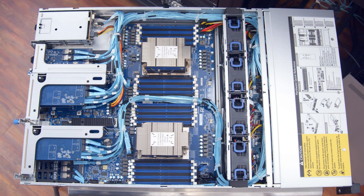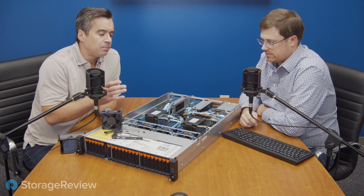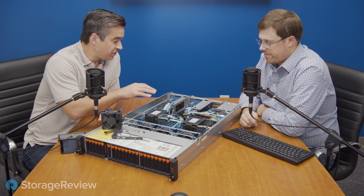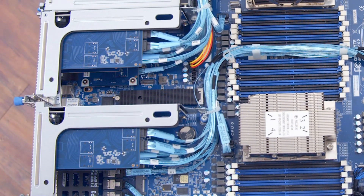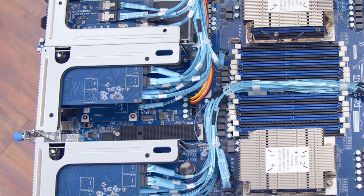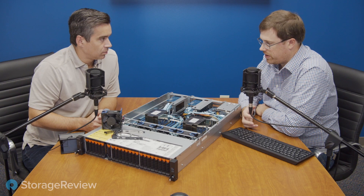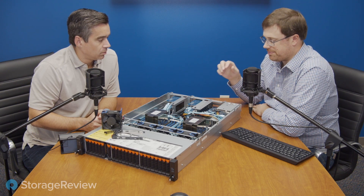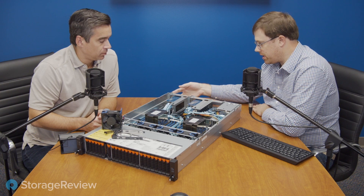As we go through the middle of the chassis you can see a lot of the cabling. This is a common design for server chassis that want to put NVMe drives in the front — we've seen it from Dell, from Gigabyte, and many others. It's probably the easiest, fastest path to get NVMe drive support in the front, but the trade-off is that in the back risers we've given up most of our slots to NVMe controller boards. It's a unique approach — some vendors use on-board connectors versus edge card slots — and with this platform there are plenty of PCIe lanes out of the CPU, so it's more of a fast-to-market solution rather than the most refined.